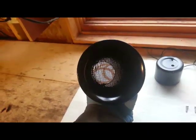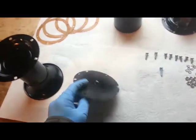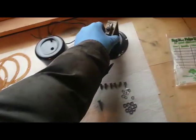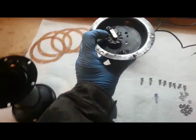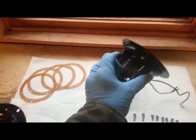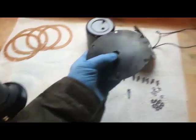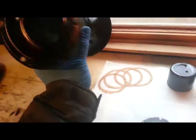It turned out pretty good, and now that all the parts are dry we can put it all together. The horn consists of this front horn baffle — it has a front screen in the front. It also has this vibration disc. You see this vibration disc has a little tab on one side, nothing on the other. This tab comes in contact with the motor body, and this body has a cam and a little wheel with raised points. When the motor turns, this little wheel rotates and hits this point here, vibrating the disc. This disc vibration comes through the baffle and makes that ogle noise.